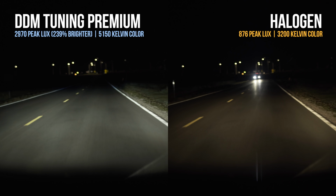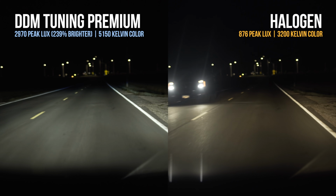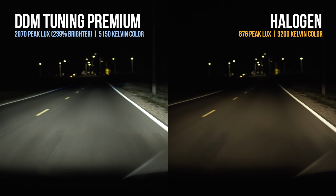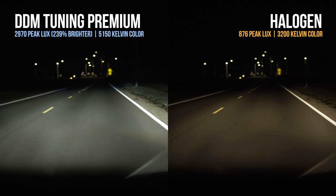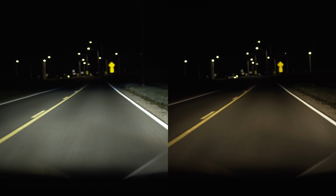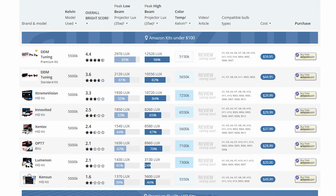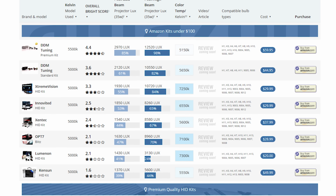So the Ddm Premium Tuning Kit was actually the closest to a pure white at 5150K in the 35 watt kit. Even though it was claimed on the kit to be 5500, we're okay with 5150. It's closer to a pure white instead of having a little bit of blue in there. Ddm Premium is really the kit to get if you're looking for something that looks stock and that's extremely bright and a great price. Now I'm going to get one more kit going for you guys.